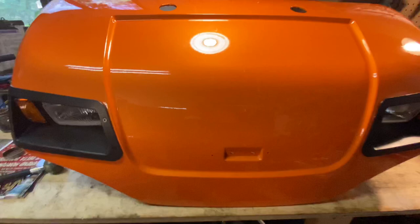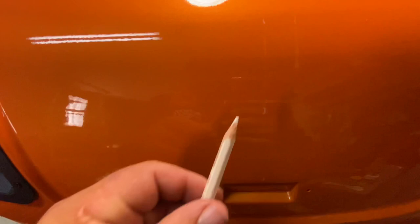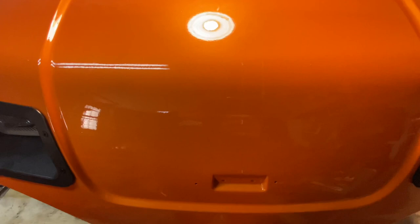Let's get started on this project. First thing I did was find the centerline of the hood and with my Stabilo pencil went in and made a couple of fine marks. Then I went back with my Kafka grid and some baby powder and lightly put in the grid marks. I do this on almost everything to keep things symmetrical, and once the paint design is done it's real easy to just wipe it off. Let's start the first color.